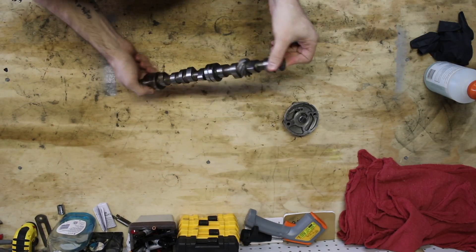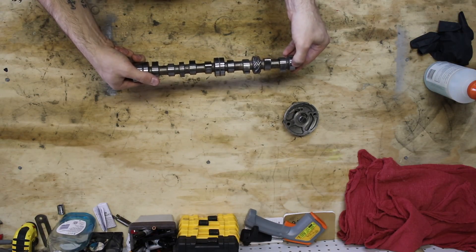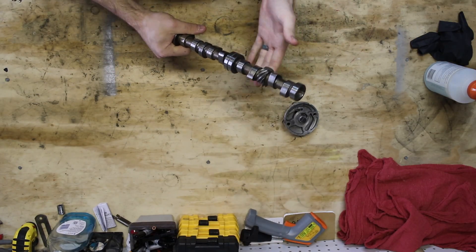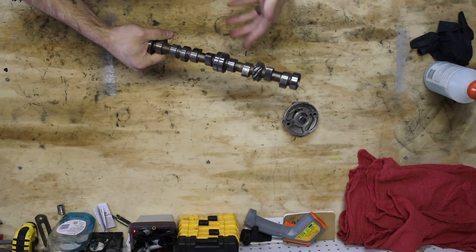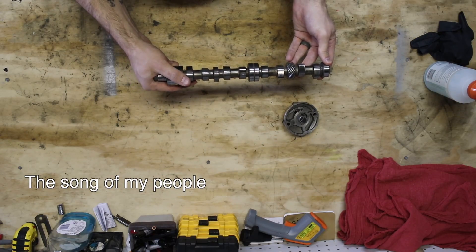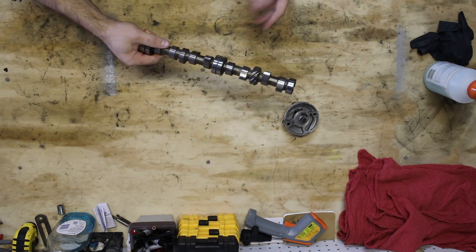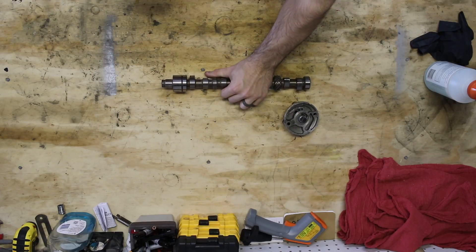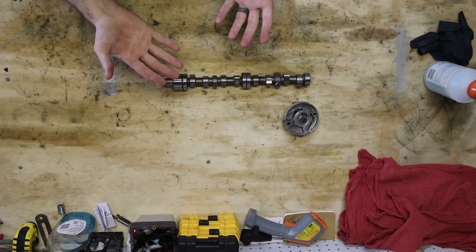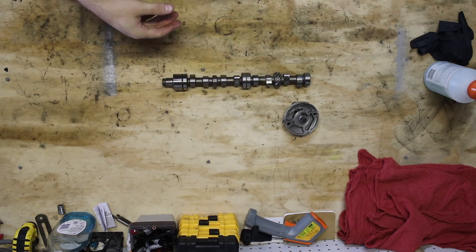With those more aggressive camshafts you get unusual noise and unusual driving characteristics — what a lot of people call camming. With a standard camshaft the motor will have a pretty regular noise, but with a fast road cam, rally cam, or race cam you'll end up with some weird profiles and your motor will sound a lot different — a repetitive but distinct sound. As you're listening to race cars at the track, you can hear that camming happening, and if you hear it, you can usually tell someone has worked on their motor.